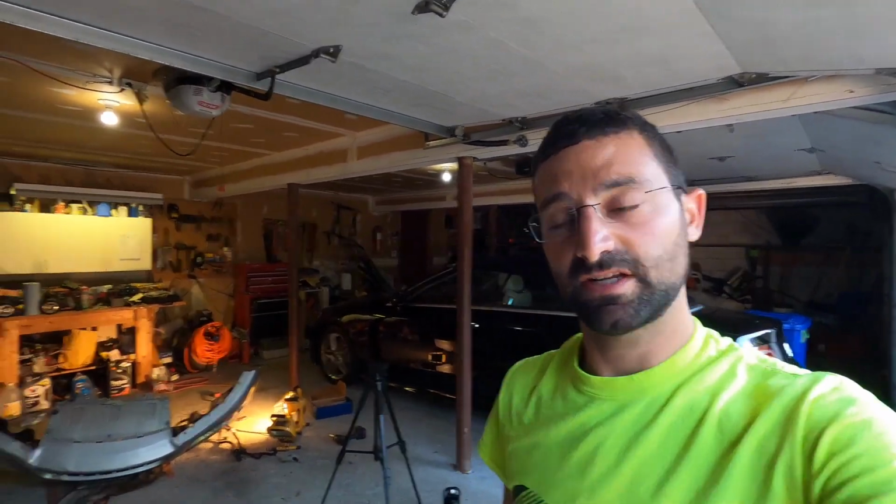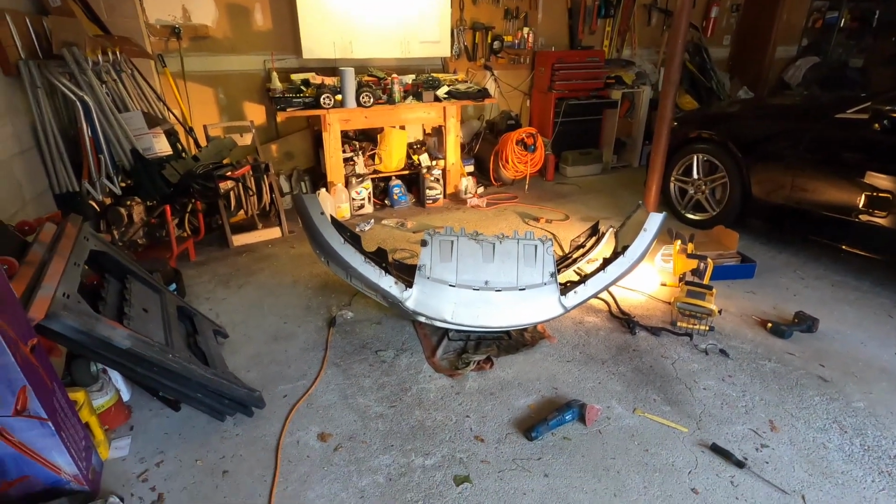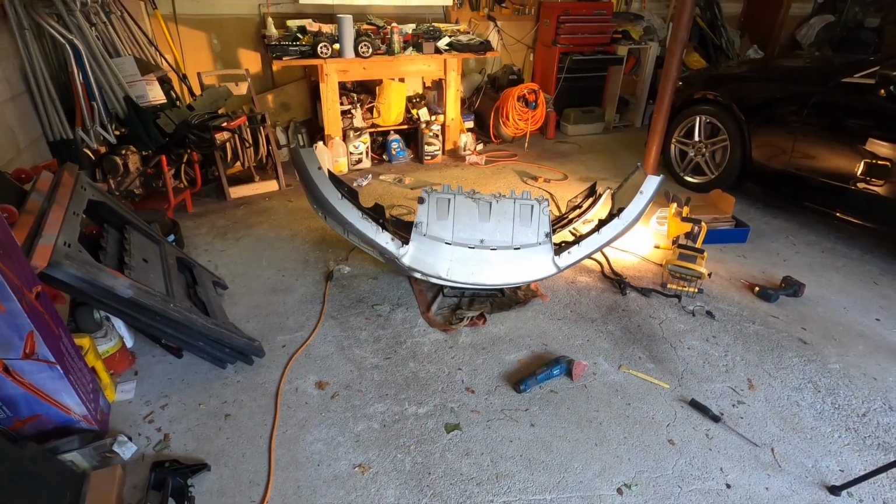And then we'll sand and get the Dremel tool out and then rework the plastic into position. And then we'll do the Dremel along the crack to get the two sides flush together, and then we'll put some plastic welder in between without the mesh, and then we'll just sand it down and prep the surface for final paint.